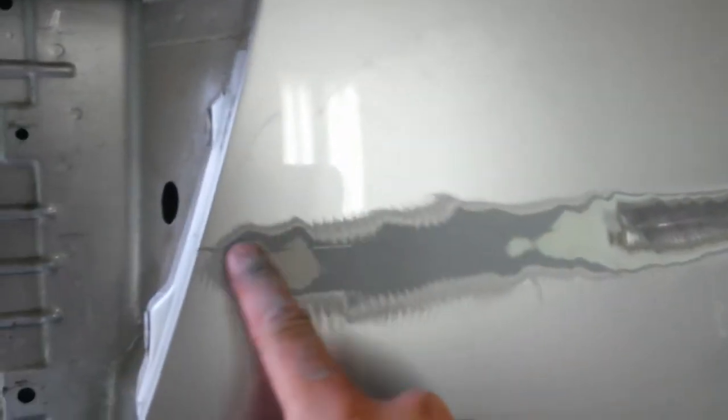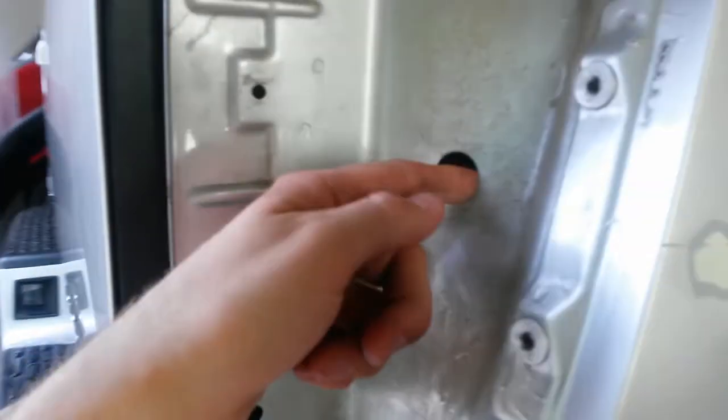I'm not excited about having to paint over a tape line in the clear here, but I'm going to have to. Normally I would just blend this whole panel up to here and go across, but this has been worked too, so I'm just going to stop it in here. He said he's okay with that - we're trying to avoid painting all the way down, so I'll just blend it right in here. After seeing this, that's probably the best way to go.